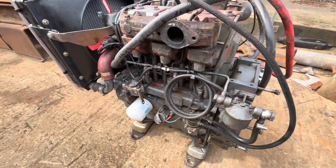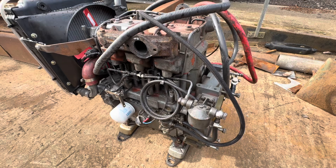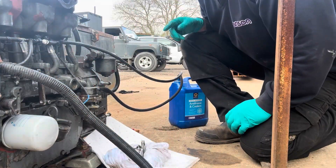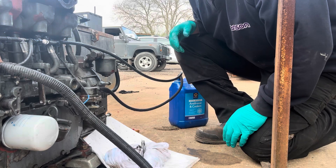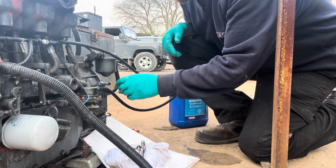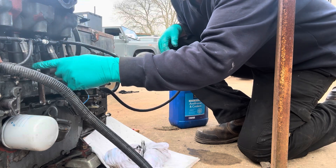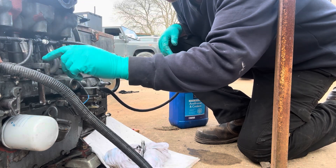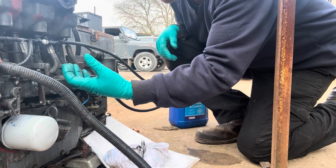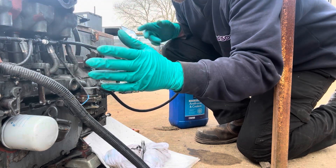What I'm going to do now is put a battery on it, get some fuel in it, give it a kick in the guts and see if it works. Now it is important to bleed diesel engines — bleeding means you need to get all the air out of all these fuel pipes. These are the little injector pumps; you've got one injector pump per cylinder. Some engines have a big injection pump bolted on the side with a cam that rotates and pipes going out to the injectors — all a similar principle.